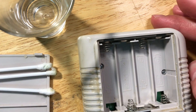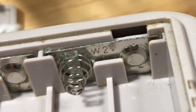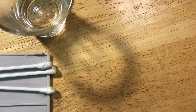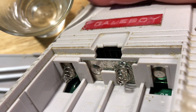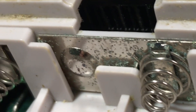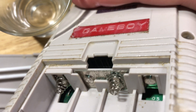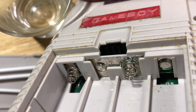A couple of dirty q-tips later, as you can see there, I've scrubbed it down and you can see they came pretty clean. A little bit of corrosion around the outside, a little bit of debris that I can remove. And then again looking at this other side here, you can see they cleaned up pretty nicely for the best. This one — that is just permanent corrosion now off of the chrome plating. So it's going to be like that, but hopefully it still picks up a contact and we'll see in a little bit if that was the issue. Regardless, these contacts are clean.